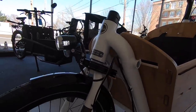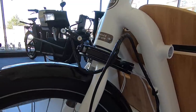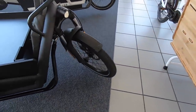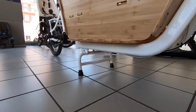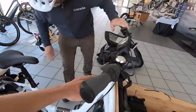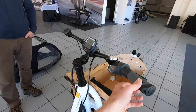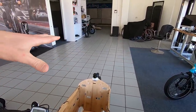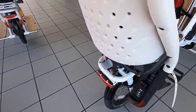Another star of the show is this cable-actuated steering — there are two cables on each side controlling how it turns and steers. It's very precise in my experience. A lot of other bikes have a big metal arm that goes all the way back, which might sit a bit lower with less ground clearance. This cable system is a very special and unique setup, and for me it's about precision. The stem has a bunch of spacers with adjustable angle negative 40 to positive 40 degrees, and slightly swept-back ergonomic grips.